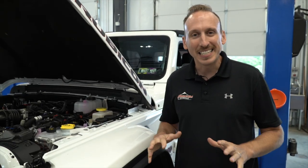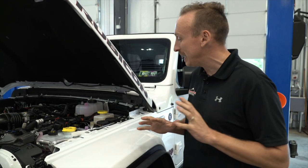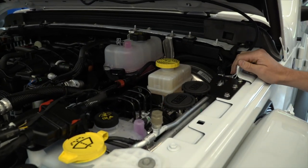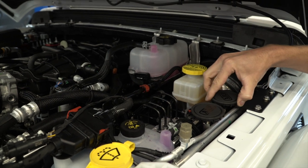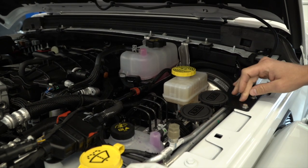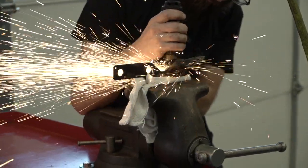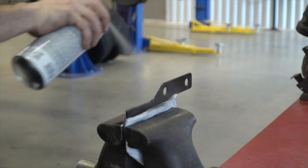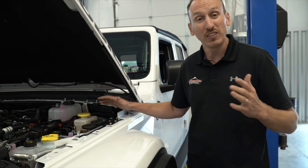We've got the installation complete — David did a wonderful job getting everything plumbed and routed, and the install looks phenomenal. Under the hood you can't tell that the air compressor is mounted down below the brake booster. One sign you can see under the hood is these two intake vents from ARB — they include a little filter in there and that is what's sucking air into the air compressor. They include this bracket from Grimm Off-Road in the kit. One thing we did to modify this bracket is we cut a tab off where you can mount a switch and air chuck, since the customer did not want those installed this way, so we cut it off and painted the bracket so it doesn't even look like it exists.